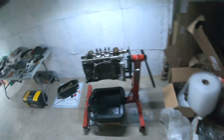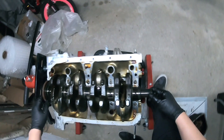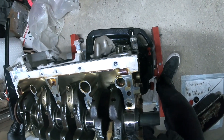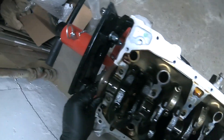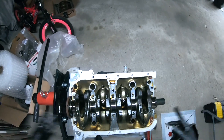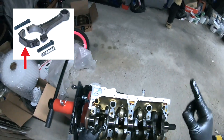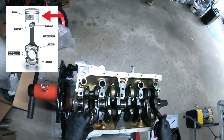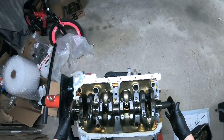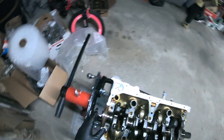Girdle is off. And then we'll have the crankshaft — these look so good. Now we will be taking the rod bolts off, taking the rod caps off, and taking out the pistons and rods. Rods and pistons are down there. We'll take out the crankshaft, and then we'll have a bare block ready for inspection and to be sent for hot tanking.